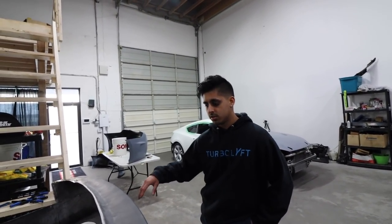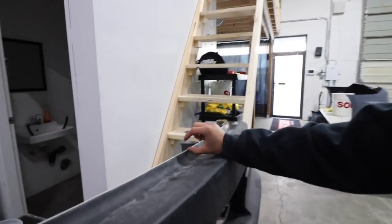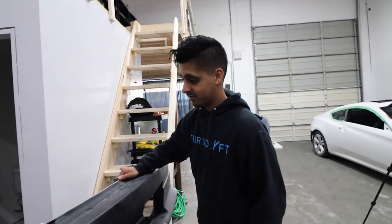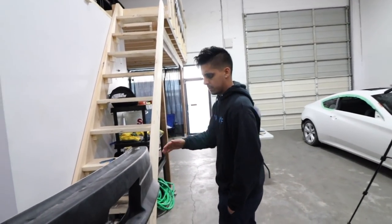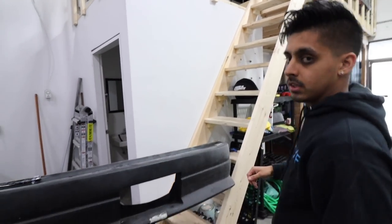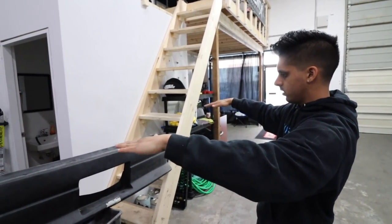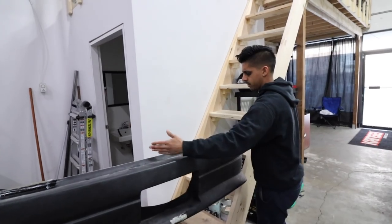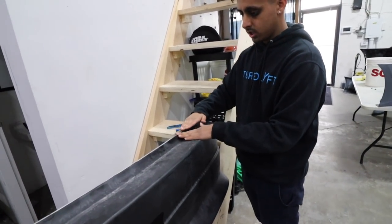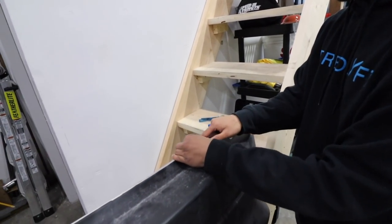Even before that. So, I don't know if you guys noticed, but like 240SX aftermarket bumpers, right underneath the center light, there's a gap about like, I don't know, 3/4 of an inch. No, I'd say more. An inch? And a half? Probably not an inch and a half, but like an inch, say. Yeah. So what we did was, like, obviously this is being over dramatic, but the bumper comes from... it has a big wave to it. The bumper comes like this. So what we did was we took these two corners and brought them down a little more flat. So this part of the bumper gets sucked up. But when we did that, it kind of messed up this whole flange that was initially here. Yeah, because it was built up and it had a flange in. So basically we just had to remake it. So we took that all down and then we just had to remake this piece.